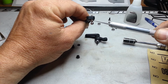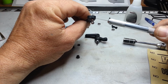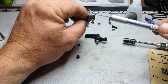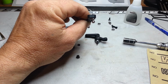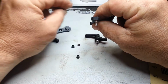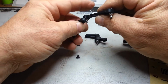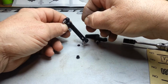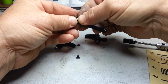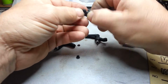And it's going to make the steering less aggressive. If you bring it up here, it's going to make it more aggressive. Your steering arm is going to collapse quicker when you swing it inward, left or right. It's going to turn quicker. It's more sudden. So I'm going to run mine to the rear because I like my car a little lazy. I don't want it to be too twitchy or too fast. I can't quite react that quick.